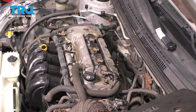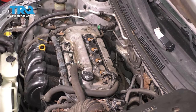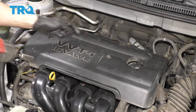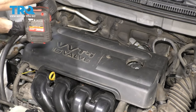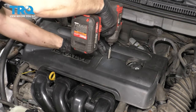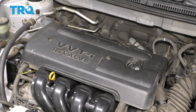Lastly, let's put the engine cover on. As always with valve cover gasket replacements, I strongly recommend an oil change after this, just in case any debris made its way into the engine. Put the engine cover right back, make sure it lines up with both of the studs, and put the mounting nuts back on and tighten it up. Take it for a road test.